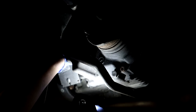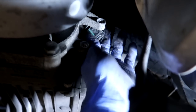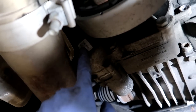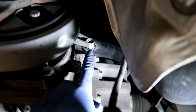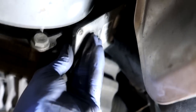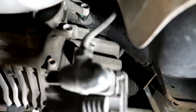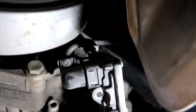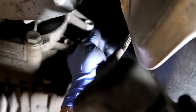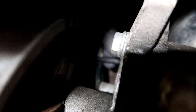I'm just trying to get a feel for it. To get at this clip I thought it'd be quite tricky, but it's actually easier than it looks. The wire goes from the haldex pump up and round and clips into what I'm guessing is some sort of ECU. This ECU is normally bolted on with two torx bits — undo the two bolts and you can drop it down. Then you can get a screwdriver and push the clip so it unplugs. Also undo the black plastic clip so you can move the wire around a bit more, which gives more room to undo that clip.